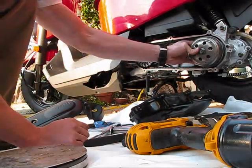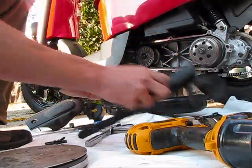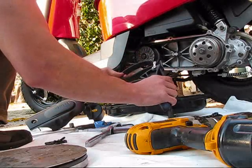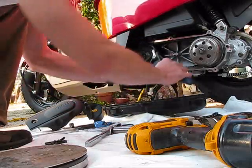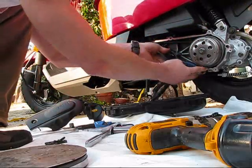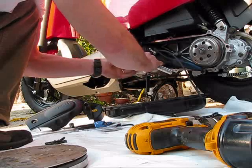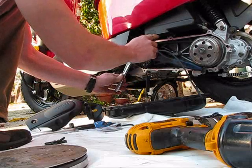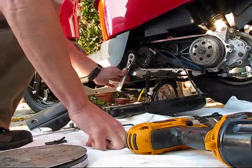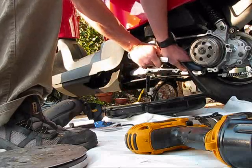Now here you are at your pulleys. First thing you want to do is squeeze this — that'll loosen that, and I've already done it so it's loose. Next thing, here's a neat trick: get this little cobalt thing, these are like five bucks a piece. Make sure that this is on the downside, face like this, go ahead and wrap it around, pull it tight, and lock it in down there right below that pulley. Also, when you're pulling up on this, make sure you're all the way down here — not up here — because if you're up here when it releases, it's going to slice your knuckle. What I like to do is a reverse grip: hold there and pull up, which keeps you from busting your knuckles.